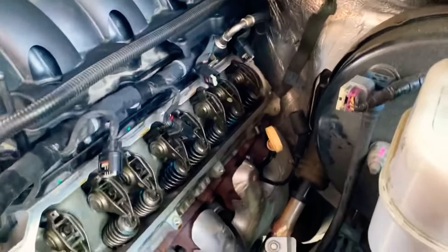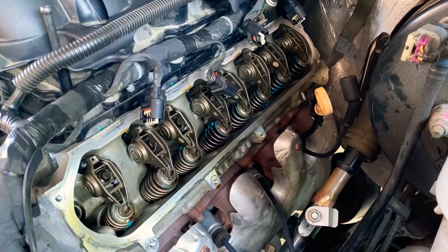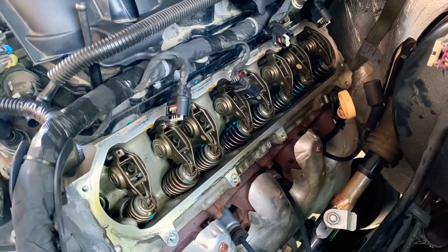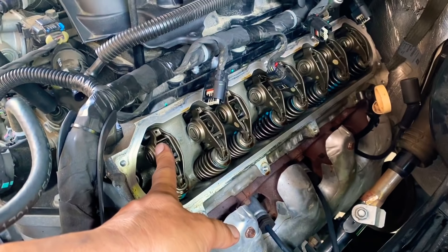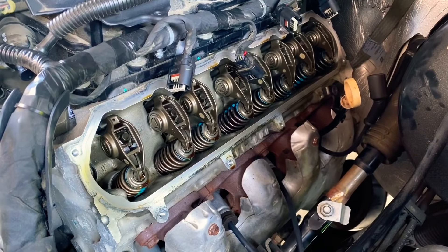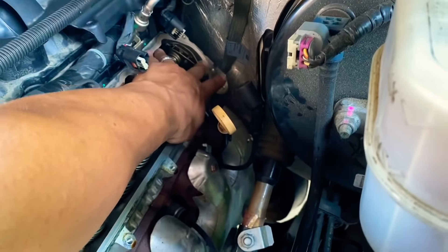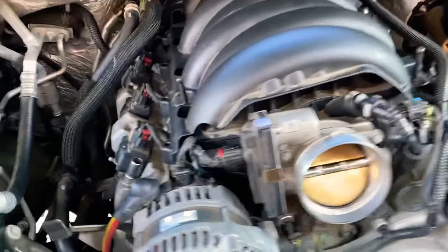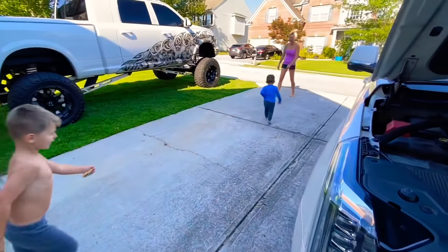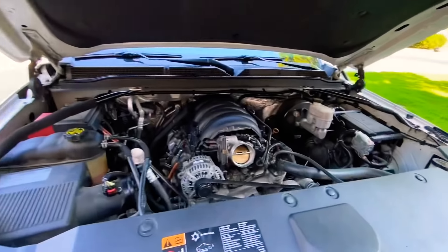Number seven lifters — I don't know if it's collapsed or what's going on. My buddy down the street does a bunch of LS swaps and Jeep stuff. We're going to delete the Active Fuel Management and go with longer pushrods and get rid of it all, then get the PCM programmed — just have regular lifters — because these Active Fuel Management lifters have some problems. So we're pulling both heads to get the Escalade going again, because number seven's not even moving and I'm having a little problem with number six too. Might as well do them all. No more Active Fuel Management.